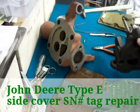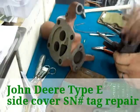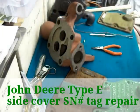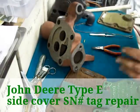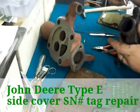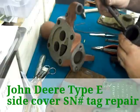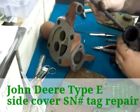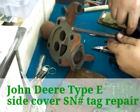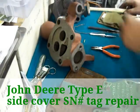I do need a muffler. Somebody stopped by the other day — the muffler was broke off in there and they showed me how to get that out, really easy. All you do is saw off your broke-off pipe level, take your chisel and grind it down to a point, kind of like a diamond maybe. Then you stick that right on the lip of where your broke-off part would start, take a big hammer — not this little one — and just hit that joker until you either cut through it all the way without cutting into the threads and it collapses, or until you peel it back.